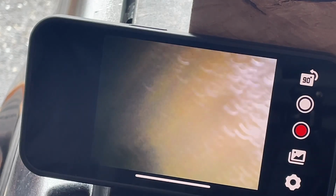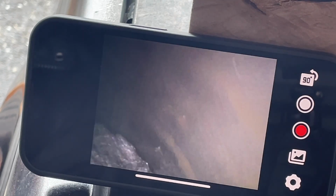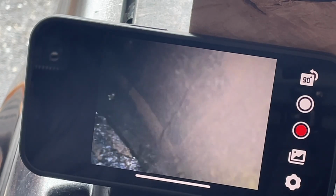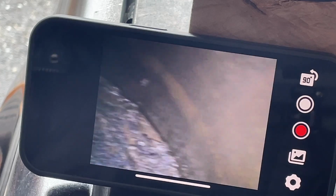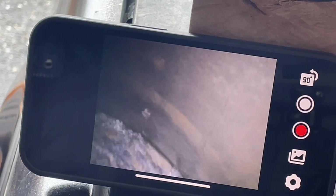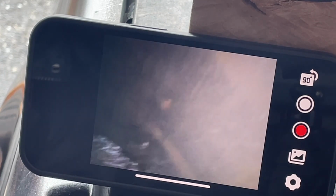Yeah. And all the cylinders could have been clean. They could have been, this thing could have a bad head gasket, coolant. Those don't look like grooves. Yeah, everything looks... I'd like to see it better, like those other sides. Yeah, this cylinder just looks like it has rusty water.